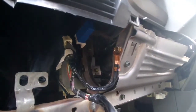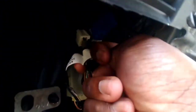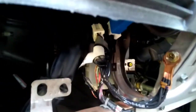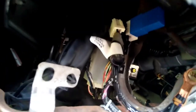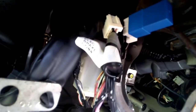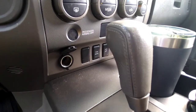You're not going to find any technical bulletins on this, but this goes for the Titan, all the 2004s all the way to 2015. This right here is your brake switch for your electronic brakes — that there is your electronic brake connector, which I will need because I'll be towing, and it also has a tow switch and a tow mode.